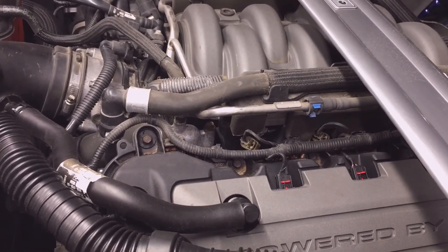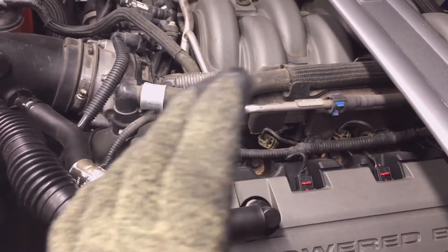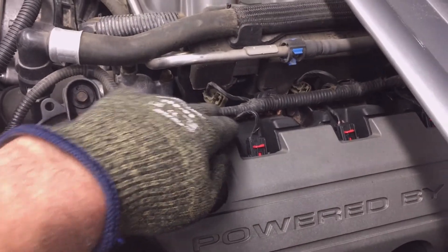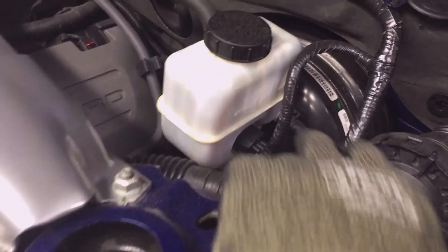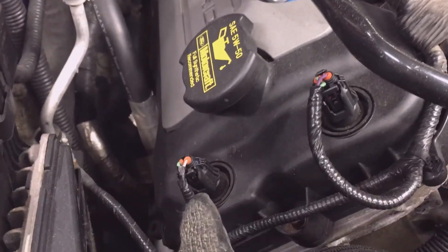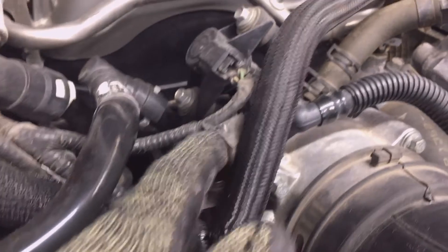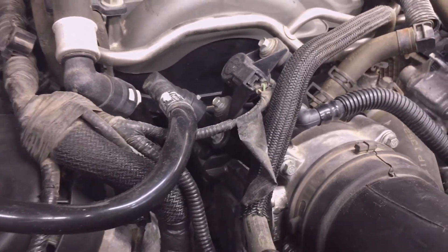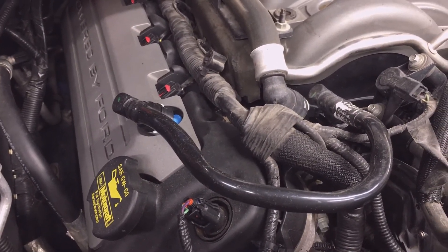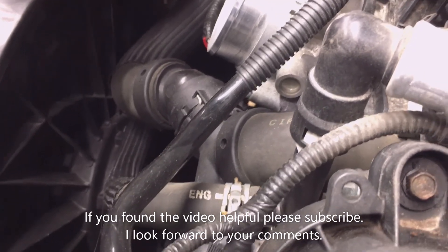Or focus on one system at a time — fuel lines, then coolant lines, then vacuum lines. With the engine cover off, you can also see the heater lines going into the heater core; check those fittings for leaks. This is also a great time to check wiring harnesses — make sure they're mounted in their locations and that all electrical tape looks good. Sometimes electrical tape comes unwrapped at the ends of harnesses; cut it off and re-tape them. Be thorough, check all your belts and hoses. If you found this video helpful, let me know in the comments, please subscribe, and give me a thumbs up.